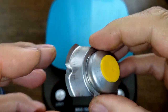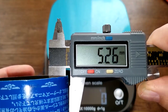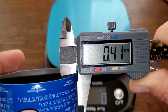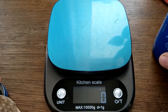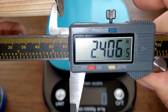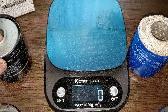The bypass valve weighs 10 grams, and the can alone weighs 46 grams. I measured the can thickness at about 0.40–0.41 millimeters, which is about average — 0.4 to 0.5 millimeters is typical. The labeling is printed on. The filter media is 2.40 inches wide. The cardboard paper end caps are glued on nicely.